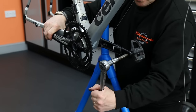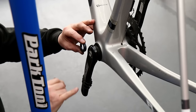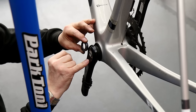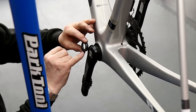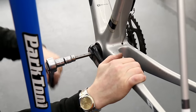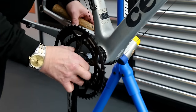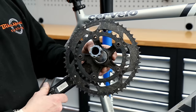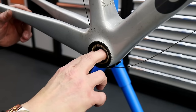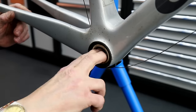We're going to take the pedals off because we're taking the chain set out to clean up, and we spotted a problem as soon as it came out. The pedal arm on the left hand side has a self-extractor — as you can see, that was missing off the bike. We keep a few of these in stock in various sizes so we can pop that into the pedal arm and use that self-extracting mechanism to remove the pedal arm from the chain set. Now we do our inspections: we look at the shaft, clean that up, take the rings off, and I could hear instantly the bottom bracket bearings had it — we're going to need to swap those out.